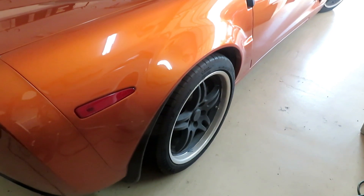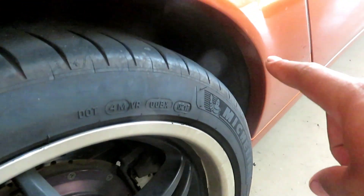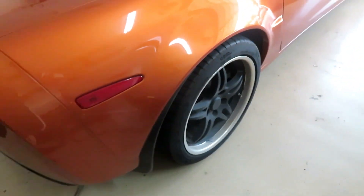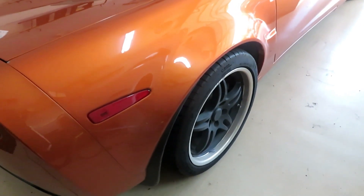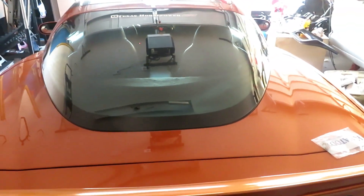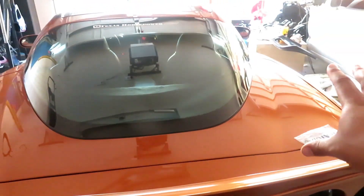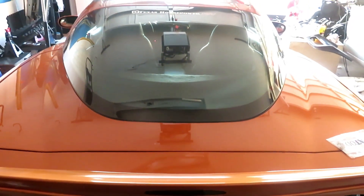What I'm going to do is take the wheel off, remove the inner wheel well plastic piece, get to the plug that goes into the sender unit, then cut the wires and splice in those resistors. My gas gauge would never read higher than half tank because the C6 Corvette has two nine-gallon fuel tanks — one left and one right. The computer averages both readings for your fuel level, so with the passenger side always reading zero, the max you'll ever see is half. The engine pulls from the passenger tank first, and since I fill up around a quarter tank anyway, this should work great.